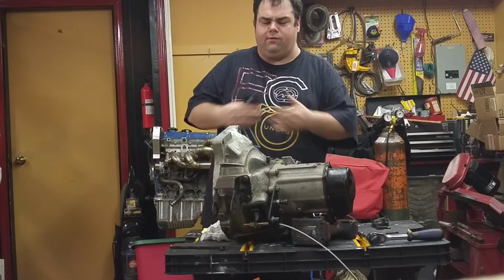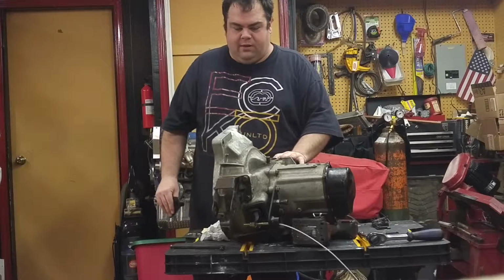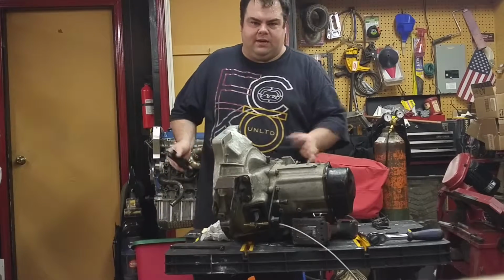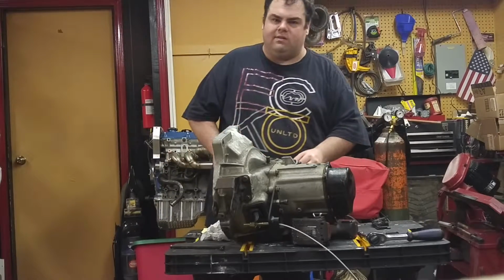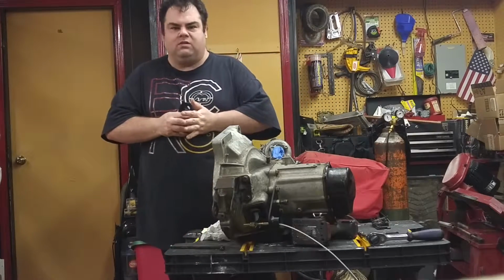But with this, you can just take the front clips of those cars, and by utilizing the Kia Rio axles in the Festiva, it'll allow you to not even have to find an XR2. You won't need to find an intermediate shaft from an XR2. You could use the Kia Rio axles with the Escort GT and Protege transmissions to have the right length.